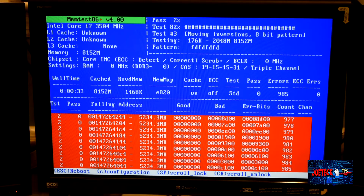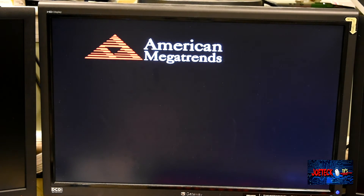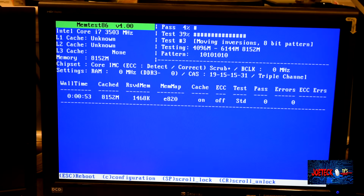Let's go to the next one. We can boot off a CD-ROM and we'll see if this memory module is okay. Obviously, to do a full test we need to make sure this pass goes 100 percent, but since the errors were right in the beginning... It's Corsair memory — a 16 gig kit with two 8 gig modules running at 1600 megahertz, with timings of 9-9-9-24. I've got four of those inside, so we're going to shut down and test the last one once this hits 7 percent.